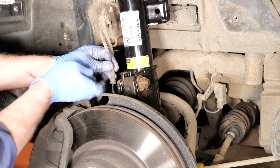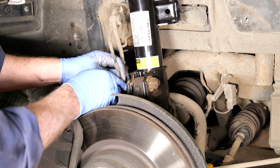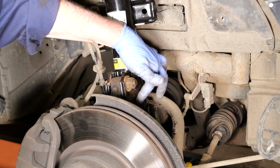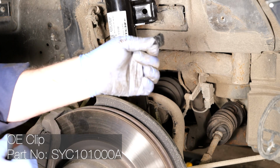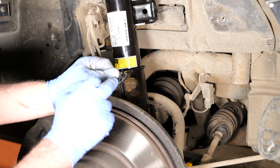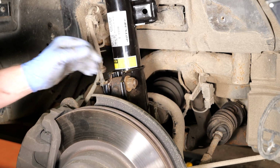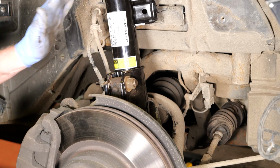And then we'll replace our ABS wire back into the mount on the bracket on the side of the strut. Now there's one thing I forgot to mention earlier. On the front side of the strut, the ABS wire clamps to it. We're using a little clip like this. Now unfortunately, very often you'll never get them out of the strut, so you'll need a pair of those to do both sides. And they literally just push into the hole, and then the ABS wire goes through there, and as you clip them shut, there's just a little V thing there, and it just clips on top of itself. So once the ABS wire is clipped up nice and securely, we'll replace the brake pipe grommet into its mount, just like that, and then we'll move on to the anti-roll bar link.